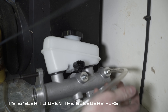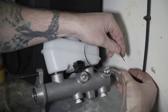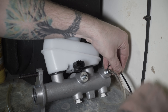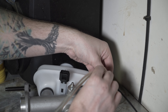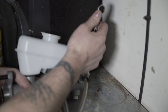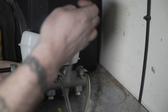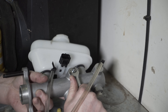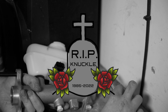To start, put the two tubes on the bleeders and tighten them down with a zip tie. You'll need to open the bleeders — maybe do that before you put the zip ties on. When you're loosening the bleeder, consider positioning the wrench to pull towards yourself, or else you might pull one out.